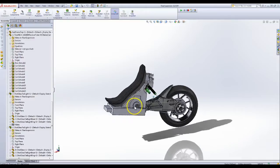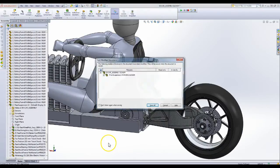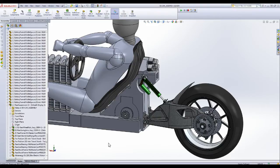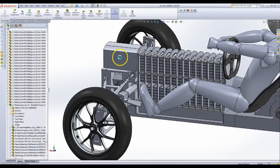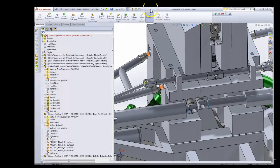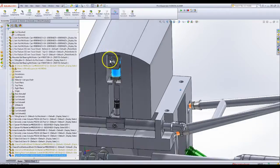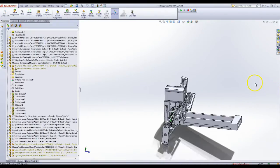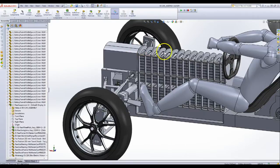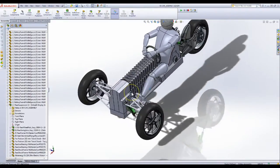So that is the rear suspension. Looking at the full car now, I have the rack and pinion coming up through here into a 90-degree angle gearbox — it's just a standard right-angle one-to-one ratio gearbox. From there I would have the steering shaft go backwards through everything, connect to the steering wheel, and that's how simple it would be to get the steering working.